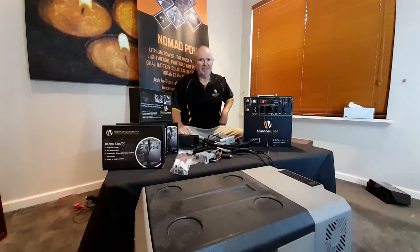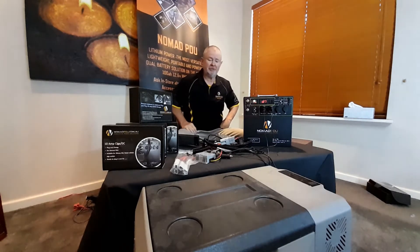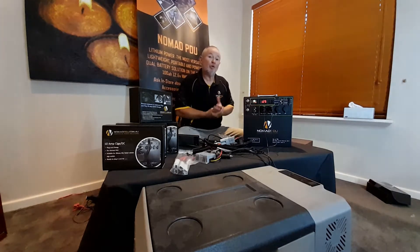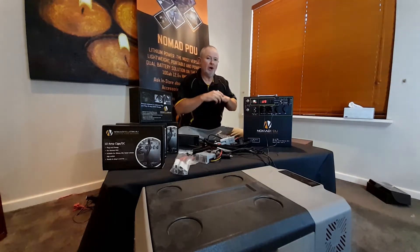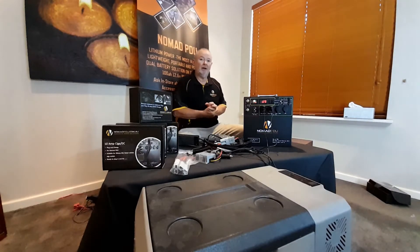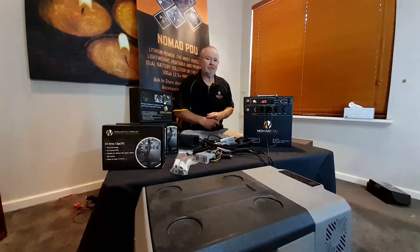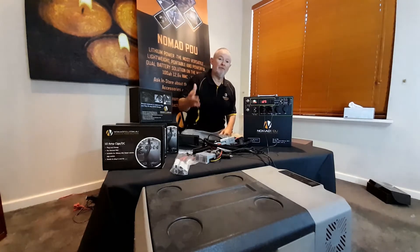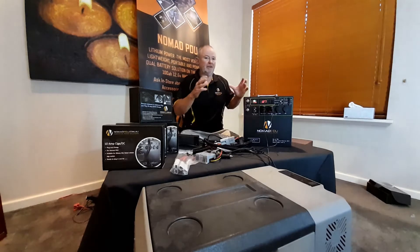Today we're going to have a miscellaneous talk about fridges — about expectations of your fridge given that we're coming into summer, heat, ambient temperature, and how they affect your fridge. With a fridge you're going to run it at about two degrees normally — that's a reasonable amount. If you're running it as a normal fridge at two, zero, or four to five degrees, it will draw much, much less than if you're running it as a freezer.